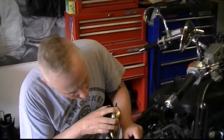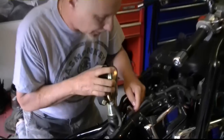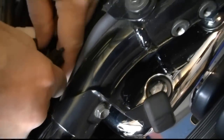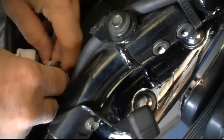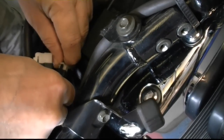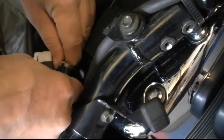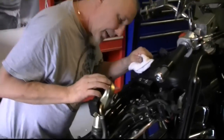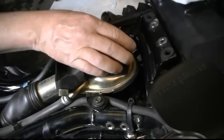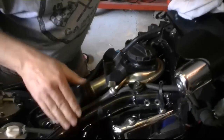Alright. I let the sealer cure overnight. Seems pretty solid. I'm going to plug them in and put them in there pretty deep. So hopefully this doesn't happen again. Click. Click. Did it push out? Alright, see, it's all back in here. Tucked in there real secure. When you put it back in, watch that the vibration isn't going to work on that, wearing that out. And if the connection's too bad where that clip was, I guess you could cut them, solder them, and put some heat shrink tape on there too. That should be good.